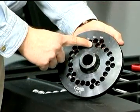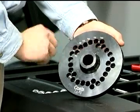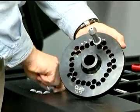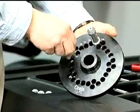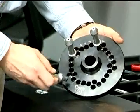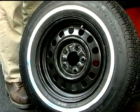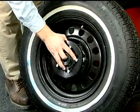Find the lug center diameter and note its position in the group of holes. Install the first pin in the hole and the remaining pins in the same hole location of each group. With the wheel off the balancer, check the fit of the pins to the wheel lug holes.